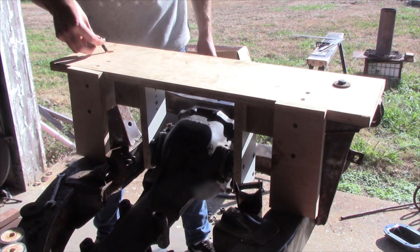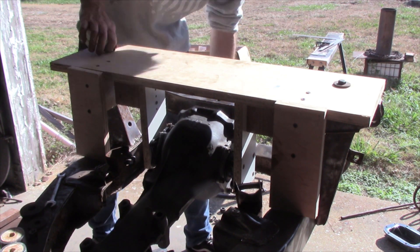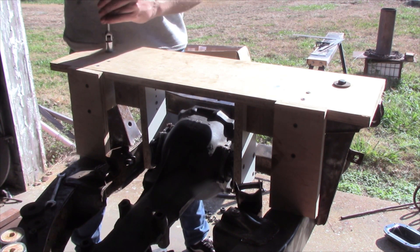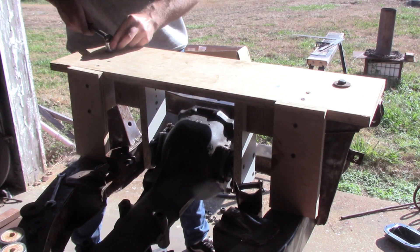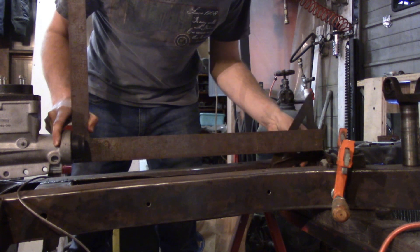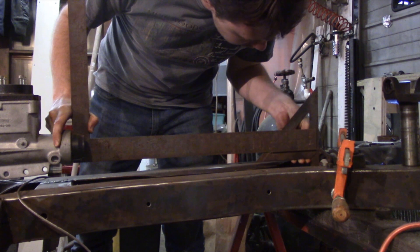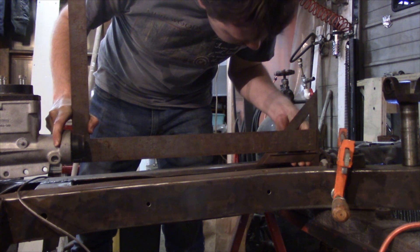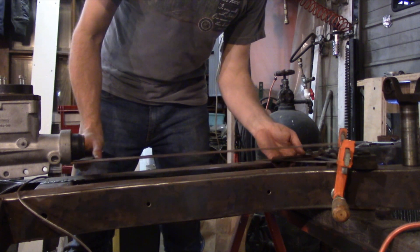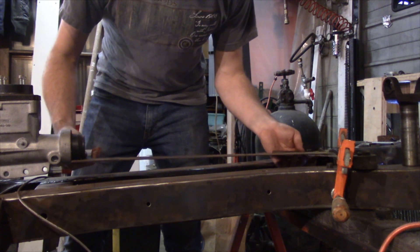Basically all I did here was the same idea as the engine and trans mounts — put the thing where it goes, then bolt and weld stuff on to make it stay there. I built a plywood fixture to hold the stub axles on the same centerline as the original. For the drive shaft to run smoothly the transmission output and differential input need to be parallel; I used a pair of squares to check this, stacking things underneath and tweaking the alignment with the clamp until they lined up. The mounts aren't my cleanest work, but they'll do.